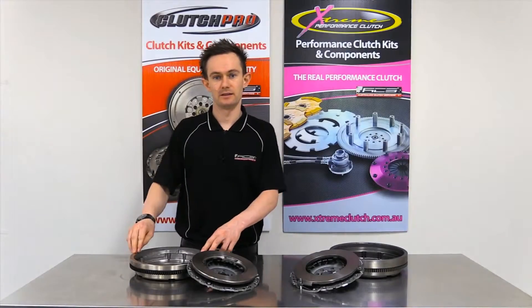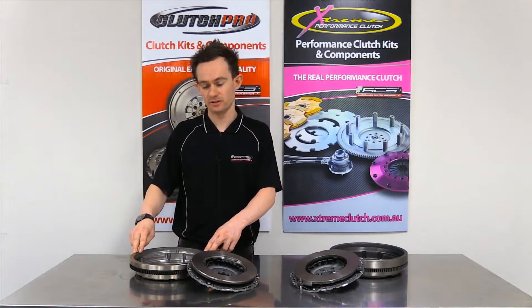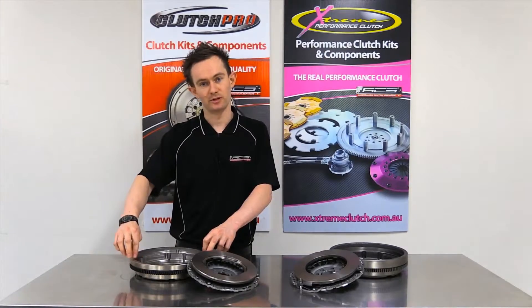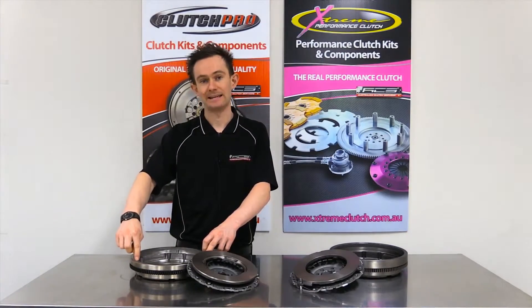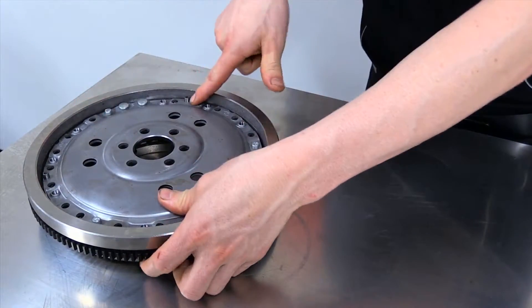What we've got here is the KSE 21001. This fits the 1.8 and 2 litre variants of the motors. This flywheel and pressure plate combination locates and indexes via the two dowels. So not only does it index but it actually centrally locates on those two dowels.